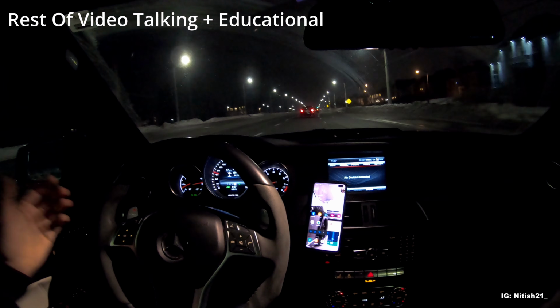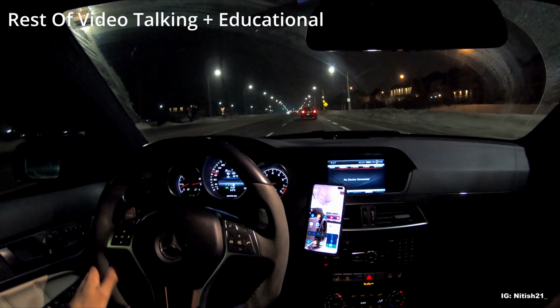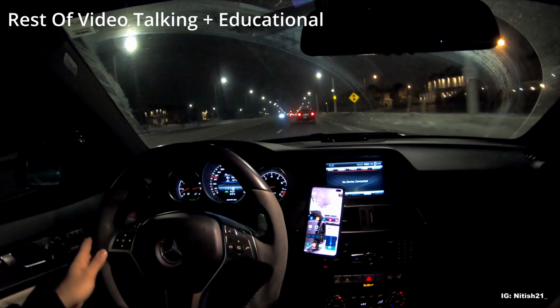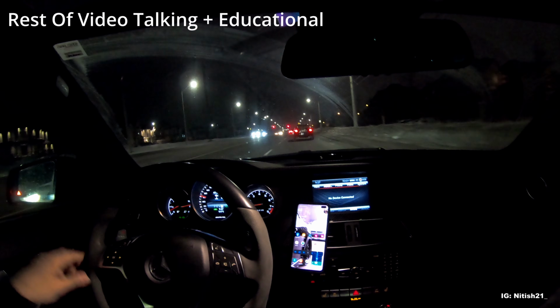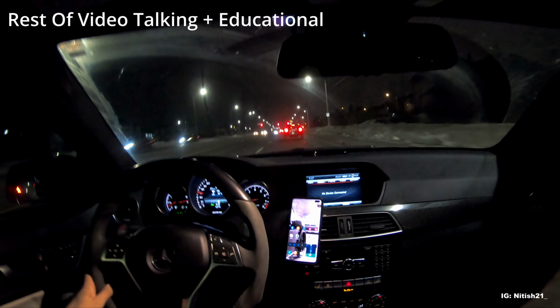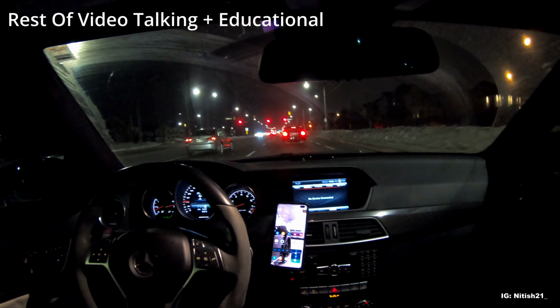So as you know, with the triple pump setup, he'll be able to then push that thing all the way up to 950 to 1,000 wheel. The end goal is 1,000 wheel horsepower, so hopefully we can hit that. It's not ideal to hit that on a stock intake manifold, but we're gonna push it anyways because we got a couple spares lying around in case something happens to it. The end goal is going to be to get like a Sohl intake manifold or something along those lines.